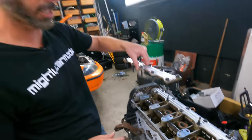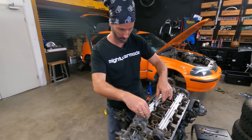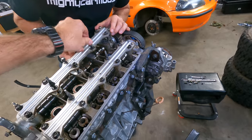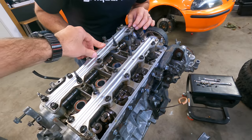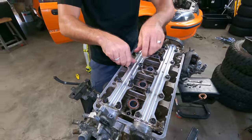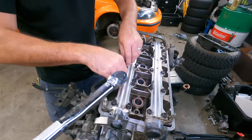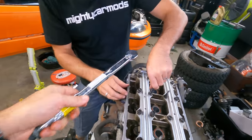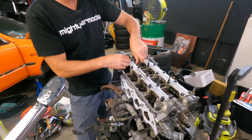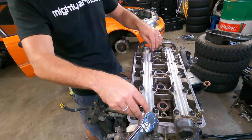Alright, this can go back in — we're basically going to hand-tighten these and then torque wrench them. They don't need much. The Honda manual says like twenty foot-pounds for the 12mm heads and seven for the 10mm ones up the end. The Honda manual is not the name of a Honda forum, Martin! Yeah, refer to the internet — there's so much info on these, but that's the problem, you start getting conflicting info. It is also good to have a manual for your particular engine.